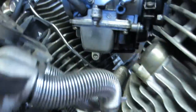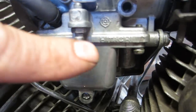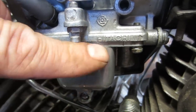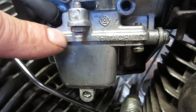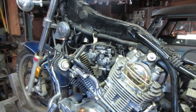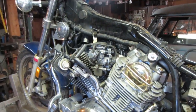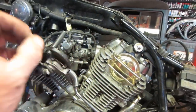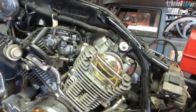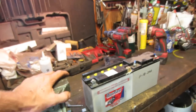I'm not sure if it's showing up, but you can kind of see how the bottom of that bowl is wet and damp right here, so it's leaking roughly in that area. I've got to pop them out one more time. Someone commented that they think the float was too high if it's leaking out the bowl — I'll check them when I have it off. I actually think it's just literally missing that section of gasket that is causing my issue.